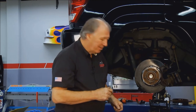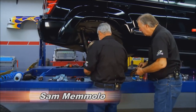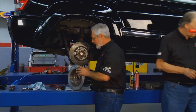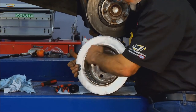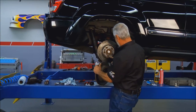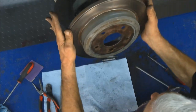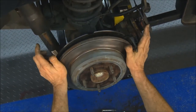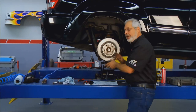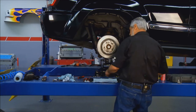When you're going to put a rotor on and put new pads on and you haven't turned it, you want to clean it up. Take a little 180-grit sandpaper, wash it good. When you're done, clean up the drum surface where the shoes are going to ride. I've got the flange surface all cleaned up. I wash it with soap and water and will hit it with some brake clean after we get the pads in. That's all there is to it — time to put in some pads.